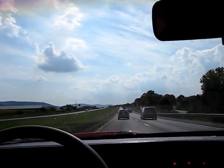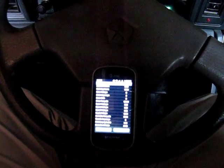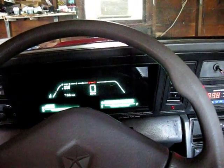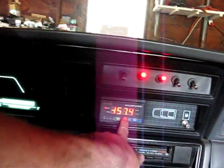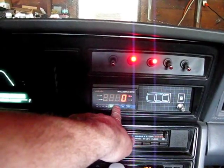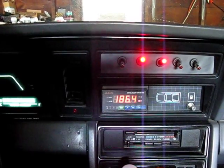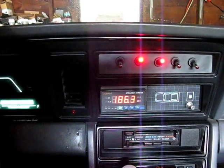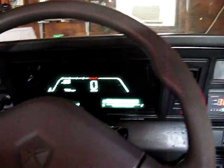Now slowing down for traffic. The final tally of our trip to Syracuse today was 79.6 miles on the trip. On the JLD 404, we've got 157.4 amp hours consumed, an hour and 19 minutes. The pack voltage is starting to settle and bounce back up — it was down to 186.4 volts. Motor temperature appears to have stabilized at 159.99 degrees Fahrenheit.